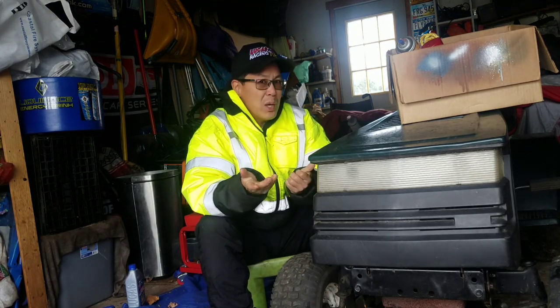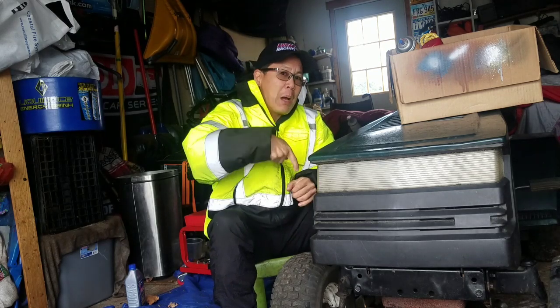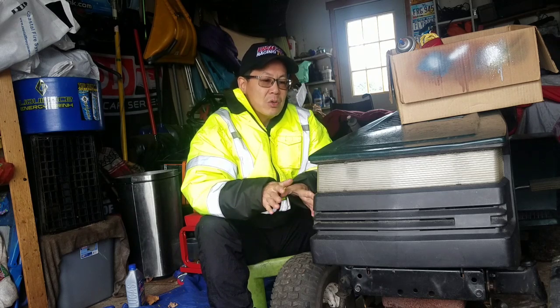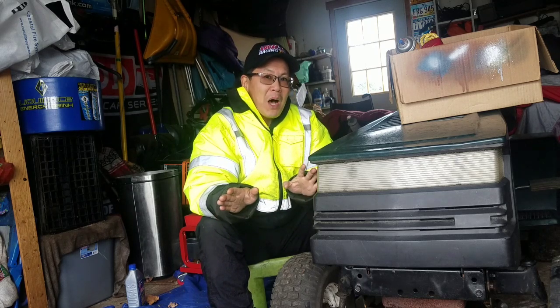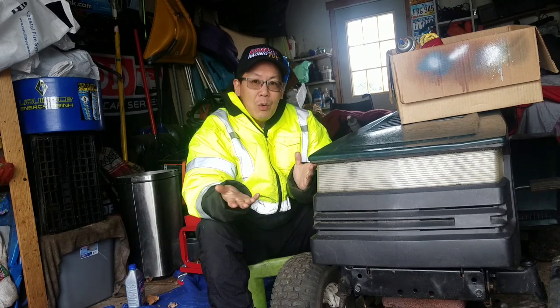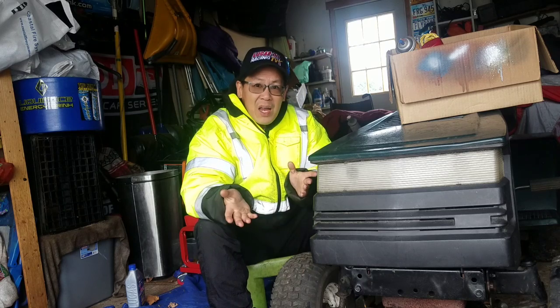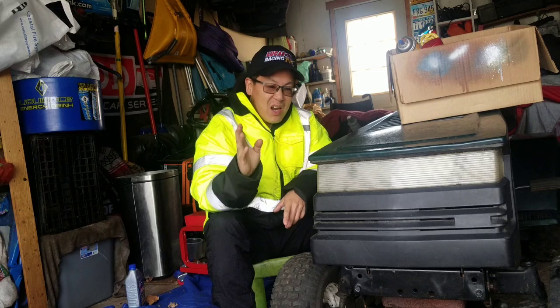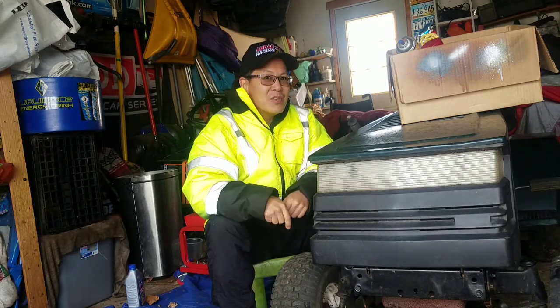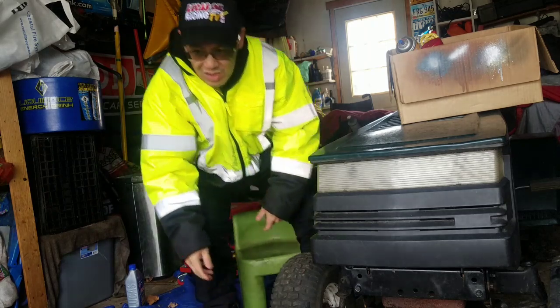But either way, as you guys saw, I drilled my own keyway in there and threw a nail in there, and then put the bolt back on. I have that other motto where if it ain't broke, don't fix it, right? So it runs great, drives, hopefully it'll mow, and then this thing is done. And it only took 8 episodes. Well, we'll see if this thing runs, you know?